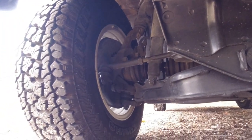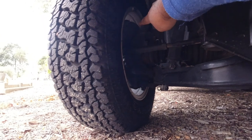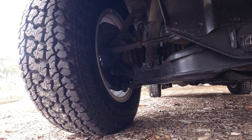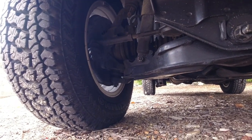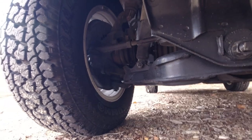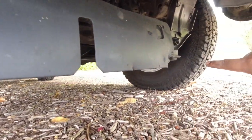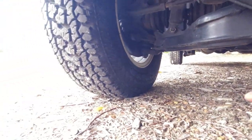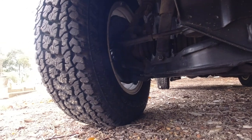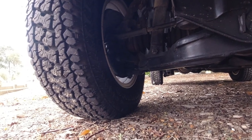So inside the wheels, you want to make sure, looking at the inside barrels and the backing plate of the brake disc, which is this black piece here, and there's a few holes in there for ventilation, that that's nice and dry, because the only fluid that will end up around there is brake fluid, unless of course it's been raining, but you absolutely do not want to see any moisture around the backing plate or sitting on the bottom of the wheel rims itself. And if the wheel rims aren't clean like this, you can always just run a rag or something across them with your fingers if you're brave enough, and it should just be dry brake dust. It should not have an oily component to it, which will indicate brake fluid leaking.